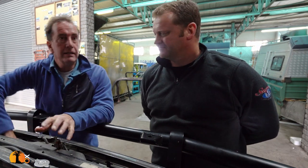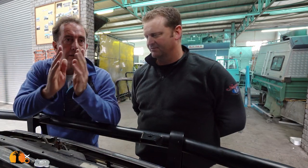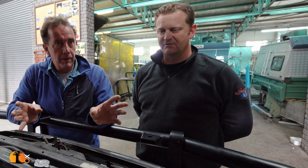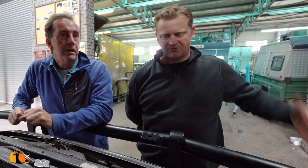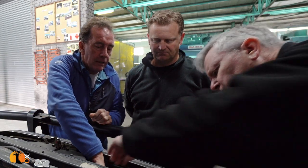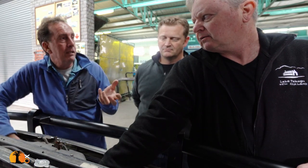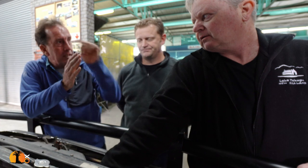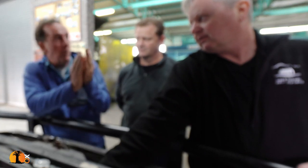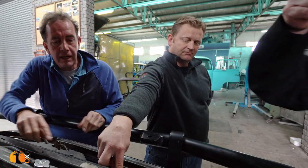When we say the radiator is bugged, you find that when you look at it visually, the little fins between the cooling channels will rot away. If you touch them they just fall off. When you're looking at these fins and they just fall away in your hand, this can't actually take away the cooling — those little zig-zags between the cooling channels are there to absorb the heat. Now with that problem it's falling apart, and the same applies to the radiator here.